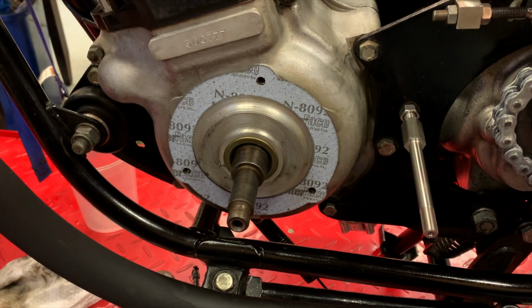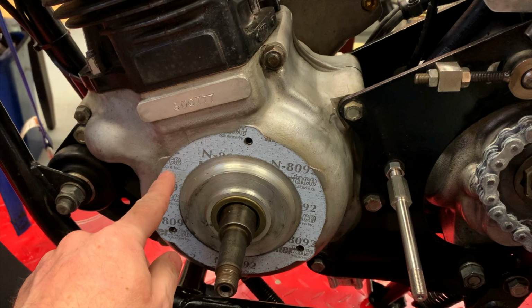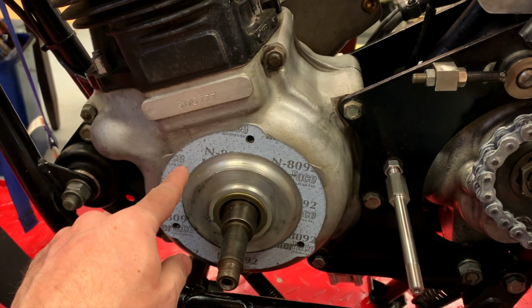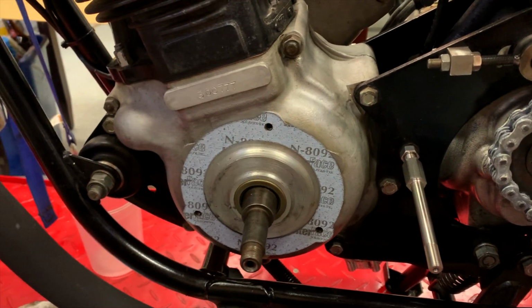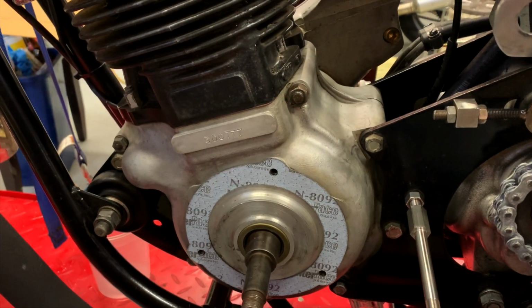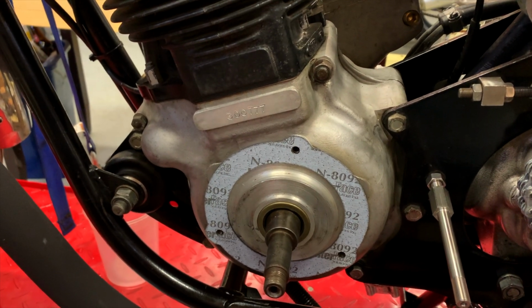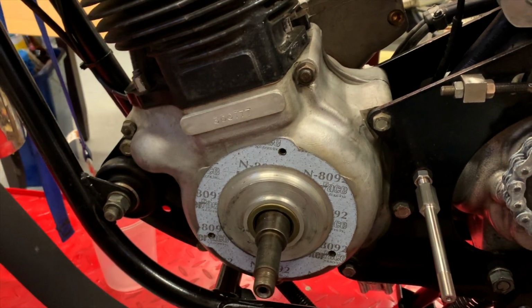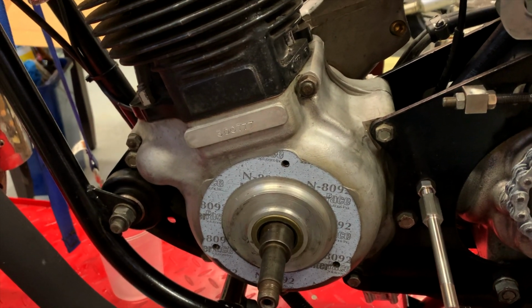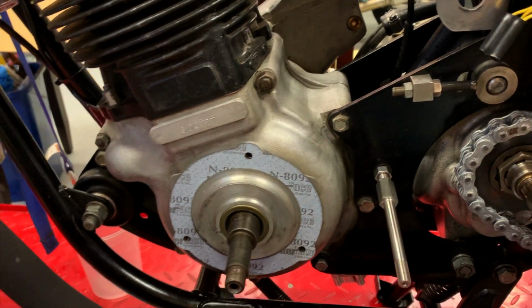I've put the crankcase gasket on, and I basically just used, on the back side of this, you can't see it now, just 3 little dabs of gasket maker, just some black RTV, and that's really just to keep it in place. This gasket really doesn't need to be covered in goo to seal, and frankly, there's nothing to leak as long as you seal these bolts when you get to that point.